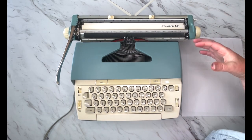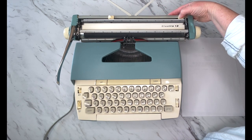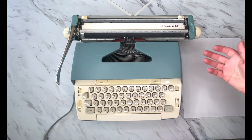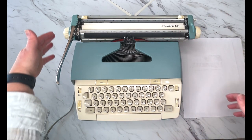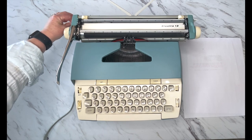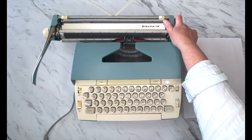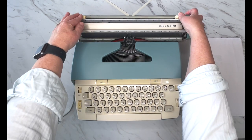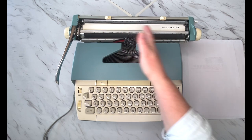Now we're going to set your margins. You do that with these little cream-colored tabs right here — you just press and drag. I'll drag it all the way out. Where your margins are set determines how wide your carriage moves. To move your carriage, there's a lever on each side. It's very common for these typewriters to have one of the levers missing — in this case mine is missing on the left side, so I'll just use the right. You pull it in and go back and forth. So now you can see the full length of the carriage. If I move my margins in, my carriage is only going to move within the margins that are set.